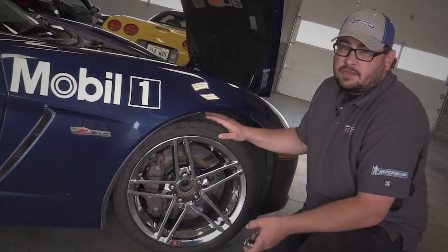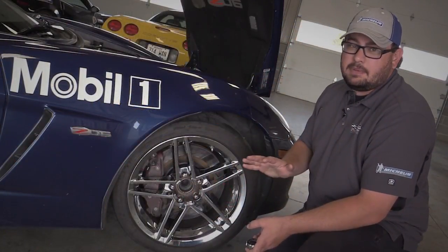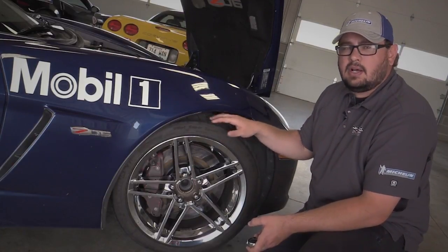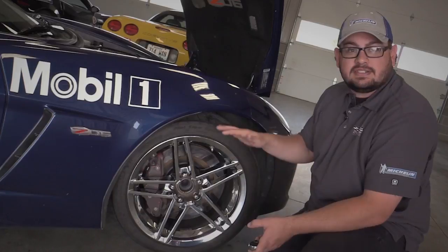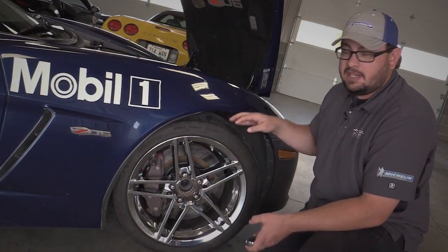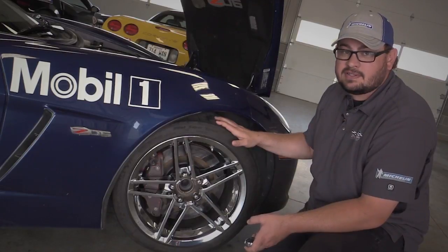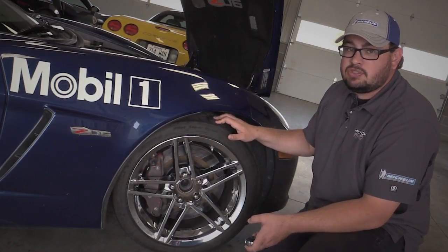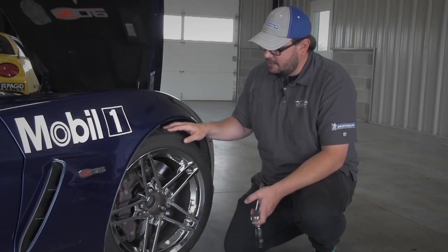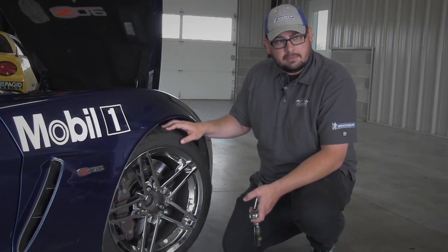When it comes to the tires for your first track day, you want to keep an eye on a few things. Tire thickness is really important. It's one misconception that you're going to go through an entire set of tires for a track day, and this couldn't be further from the truth. We typically, especially in our Michelin Pilot Super Sports, get about 2,000 to 3,000 miles out of a set of tires. Track-only miles, but there are a few things you do want to keep an eye on.